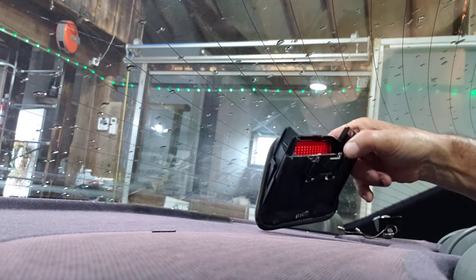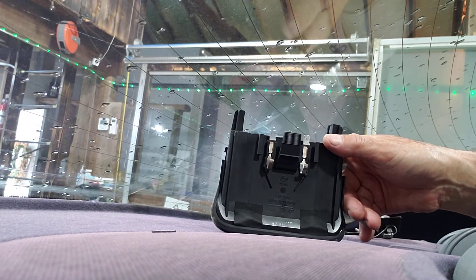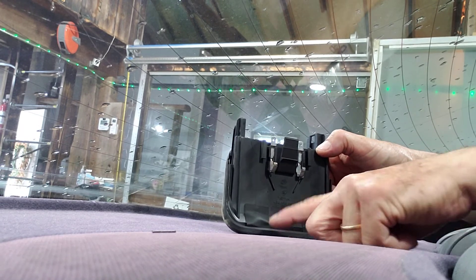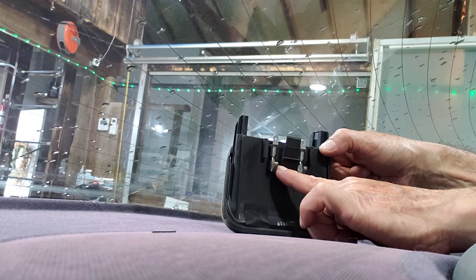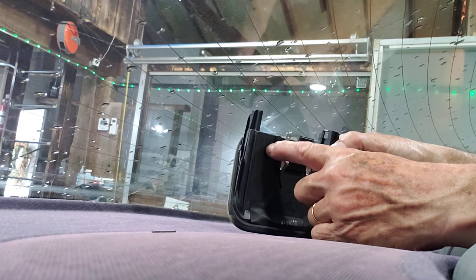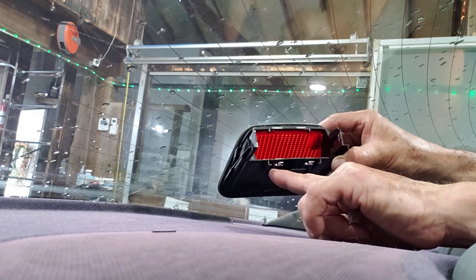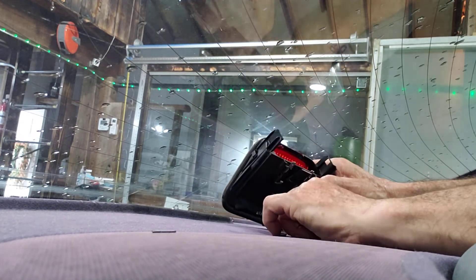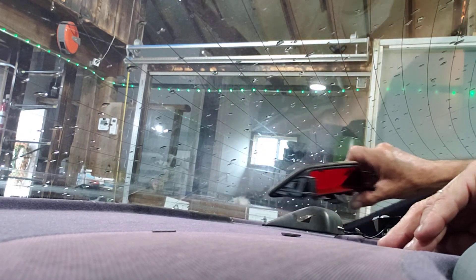Usually you grab the light and pull in your direction. I pulled on both sides in my direction and it released from the track. What's holding this light in place are these little tabs over here, which give power to the light bulb, and this little tab over here. You can see how it goes in on one side and the other, so when you grab it and pull in your direction, both release at the same time and you pull it out — no problem. I hope that'll help one of you out there. Bye bye!